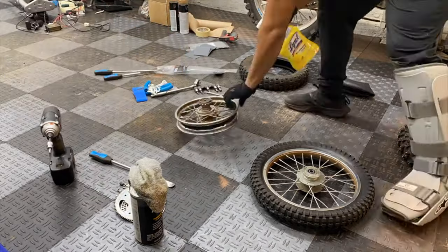Here's the battery pack that I'm using for this bike. It's by CalMM, which is a Chinese company. These type of batteries aren't usually the most ideal choice if you're looking for absolute max power. I chose to go with this one because of the 50 amp BMS. It's also got a built-in 12-volt output USB port, so I can hook up additional lighting or charge my phone whenever I'm riding my bike.